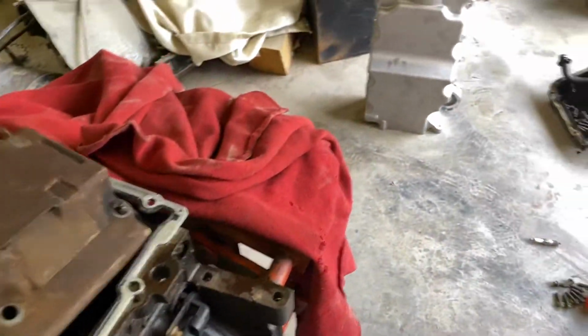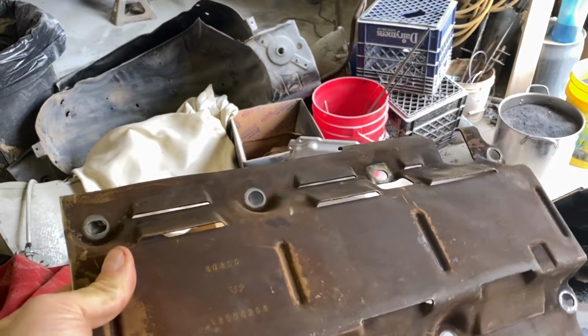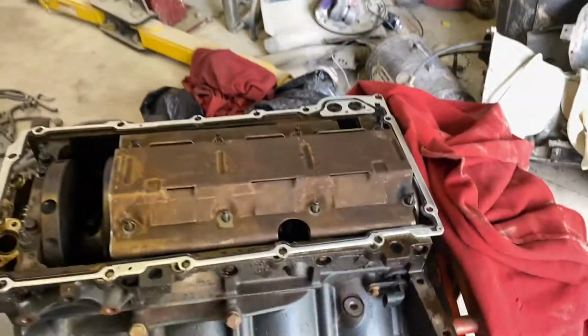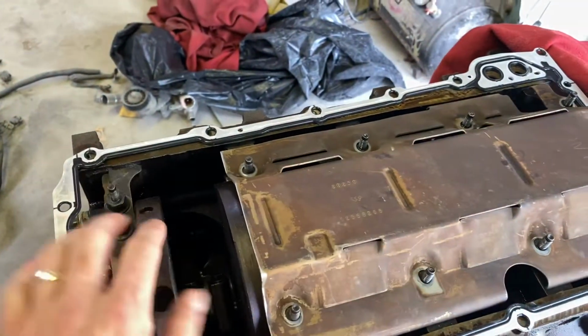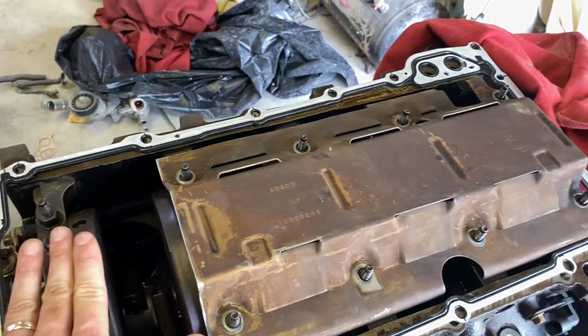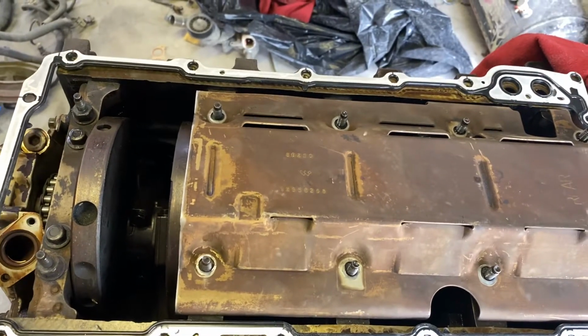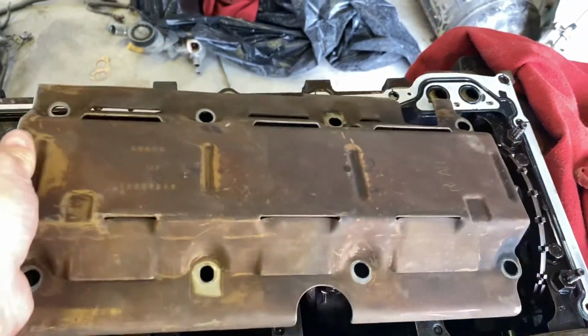If you got a truck engine and you got the truck windage tray, you want to cut it. Instead of buying the proper F-body windage tray as it recommends, just cut it, dude. It's not a big deal. The front of the pan almost comes down about that much off of the crank here, and this is a 5.3 and 4.8 crank. This is the factory truck windage tray.